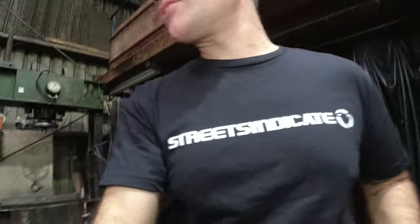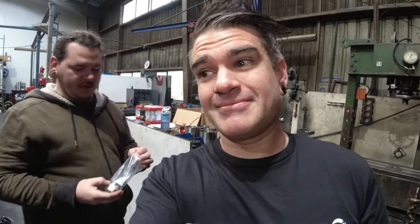So the whole purpose of this is to be able to fit that wider oil pump collar onto my new crank so that I don't have any kind of hectic oil loss when I'm sitting on two-step for 10 minutes at a time. I probably won't do that, but I would like the added safety of just knowing that my oil pump drive isn't going to be a problem.